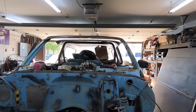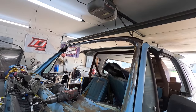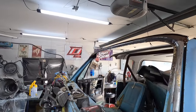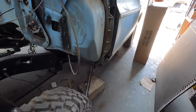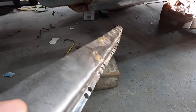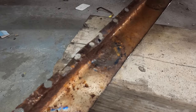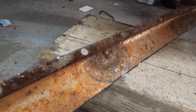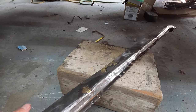If you'll notice, something is missing up here — basically the top of the truck. And then we also came around here and took this panel out. I was working on this and I'll show you down here. This is our friend, and it is beat to hell. It's brazed, which means you can see with the heat where they put a bunch of heat in it, and then they pushed it way in and stretched the metal here. So you're not going to get that back into shape. I was looking at this thing and it was terrible.